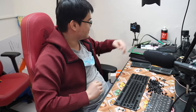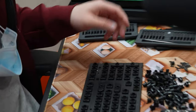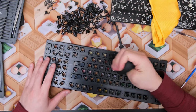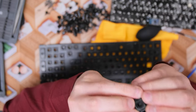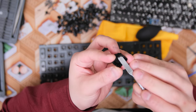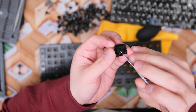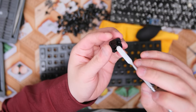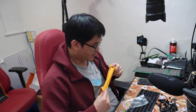I need to clean this up a bit using our cleaning kit — a little brush, some cloth, and a stress ball. I'll dust it down because there might be some residue from years of use. For these housings, the slider only contacts on two points, so we'll be applying lubricant on the rail edges — that's all you need for lubing the housings.